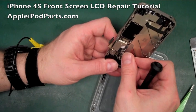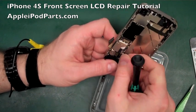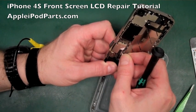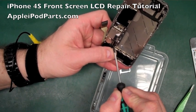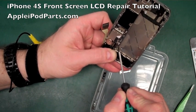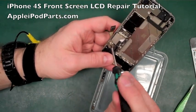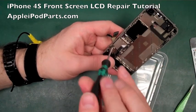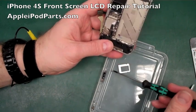Aerial connection comes along. Again, this is one of those circular connectors. By the time you've routed that cable, it should find its own rough way, and then you're just looking for that very firm click as that's in place. That basically wraps underneath the bottom of the castellated screw, around it, through that little bracket, and then into position. Screw in the corner of the board here. That one goes in like so. What we're left with: 2 bottom screws, 2 battery screws, and that bracket.